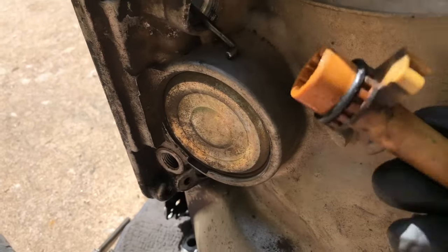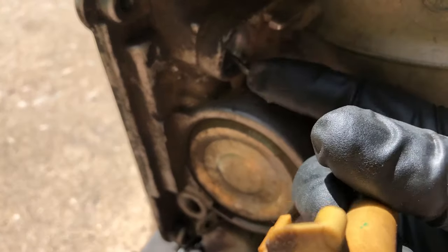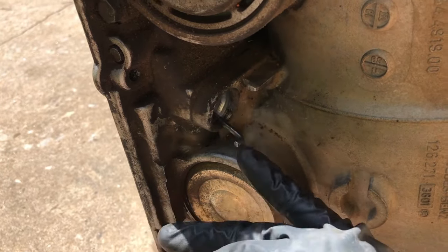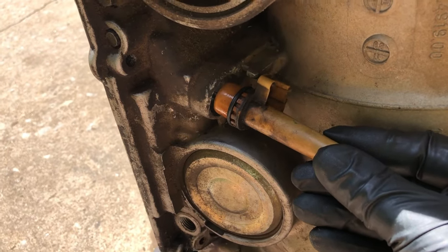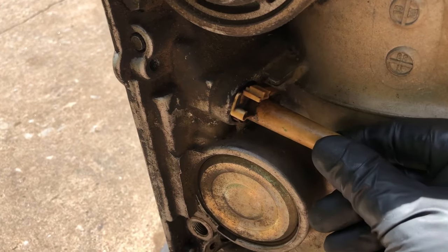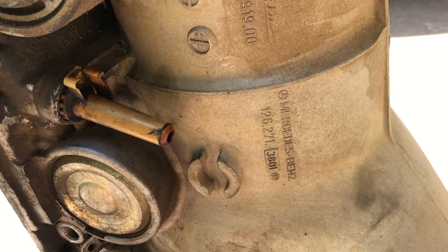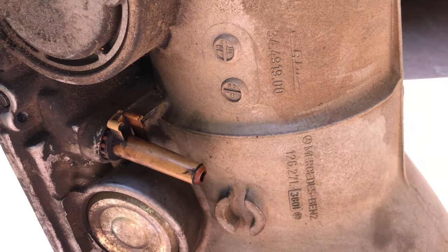No, at the bottom of this thing there's a little plastic cap with a hole in it that this arm sits into. So you have to push it down, get some needle nose pliers, hold this right here in place, and then put that little cap on it, let go, and the arm sucks it up because it's spring loaded. Then you push this in, tap it a couple of times right here, and twist it, and it sits just like that. And then your Bowden cable comes up here, and then it runs up to where your throttle plates and all that kind of stuff are.